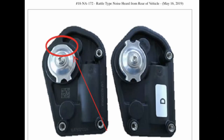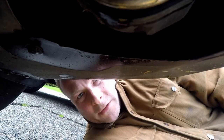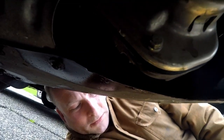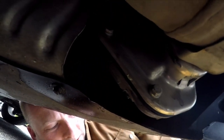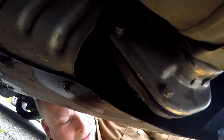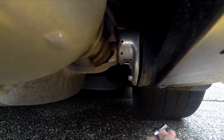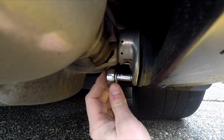Here are photos from the internet — you can see the one on the left had the leg removed. Now we're going to take the actuator off. In order to do that, you've got to take three 8mm bolts off right in that area there. You can see the bolts on the inside or the inner flange. Here's a much better picture from the back of the car of the valves and where the bolts are.